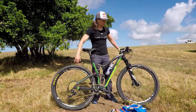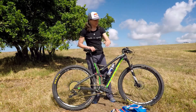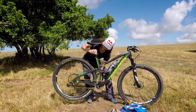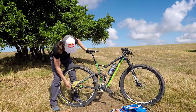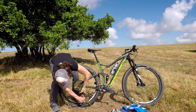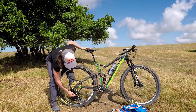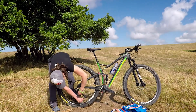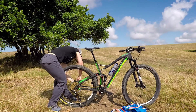First things first, I'm going to do a rear tire because that seems to be more intimidating for people because you've got the cassette and the derailleur. The first thing I do is shift to the smallest gear — that just makes it easier to get the chain on and off. Then if you have a SRAM derailleur, they've got a cool little lock thing that you can push to take the tension off the chain. If you don't have that, it's totally fine — you just use your thumb to take the tension off. That makes it easier to get the wheel out. Start there, then take out the skewer quick release.